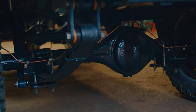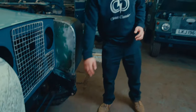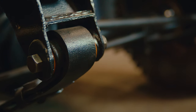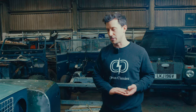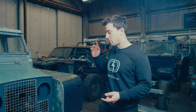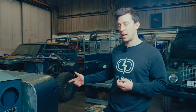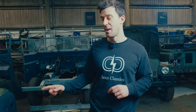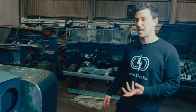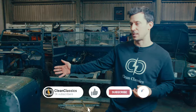We took the good chassis and running gear, fully stripped it apart. The older galvanised chassis has had a clean up and a lick of paint to make it look good as new. We've fully rebuilt the axles, replaced bearings and seals, and replaced all the bushes with poly bushes. The brakes have been gone through and redone — this has got a disc brake system, which we believe are Santana disc brakes. Santana was a company in Spain that bought the rights to manufacture Land Rovers to Series spec, and it took us some time to figure out where to get the brake pads from.